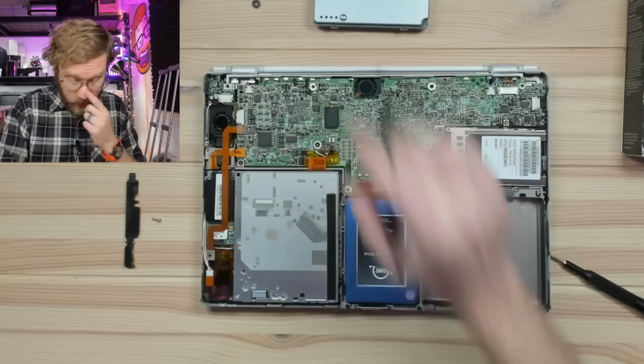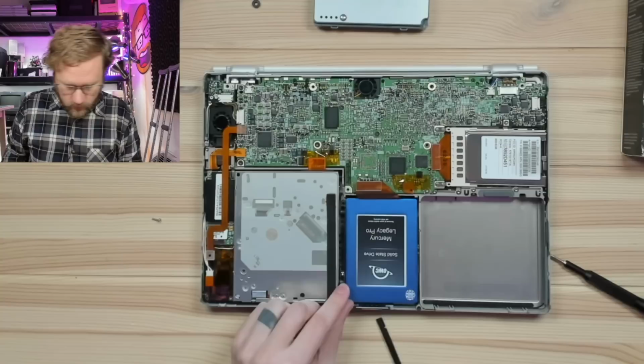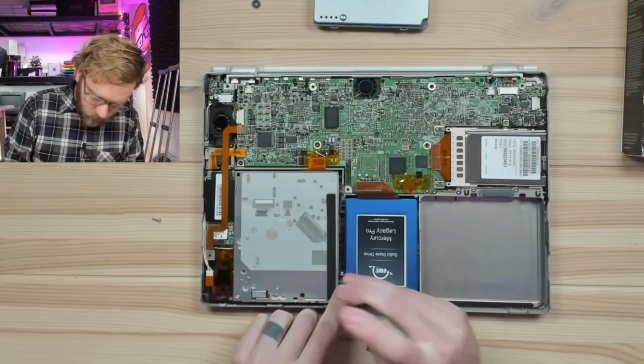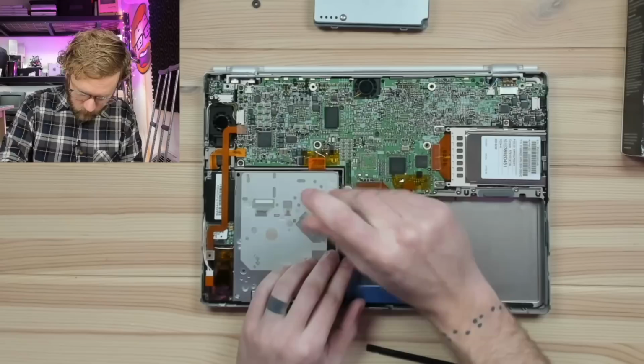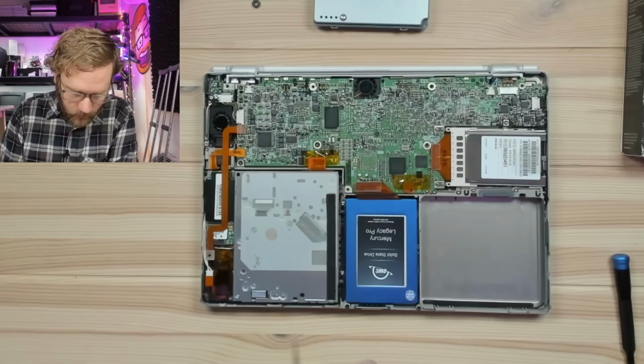And we will put our little cover piece back on. So this is actually what screws down the drive. So it's mounted through holes on, well, just one because it's missing the screws. And then this is what holds it into place. So we'll put this back down. And do the top one. Just getting them snug and don't want to go wide on that because that's plastic and you could definitely crack it because this plastic gets hot and cool over time. And obviously I don't want to crack that piece.